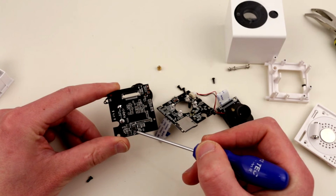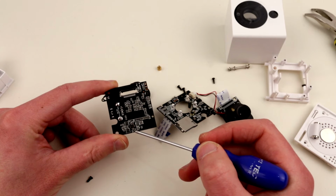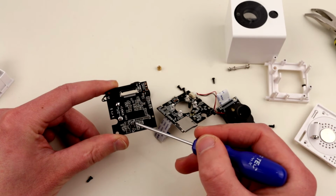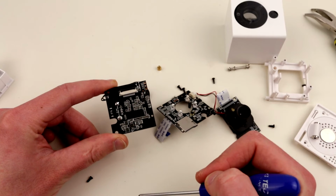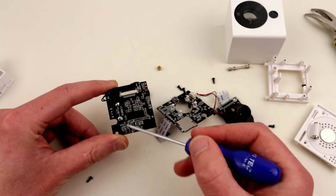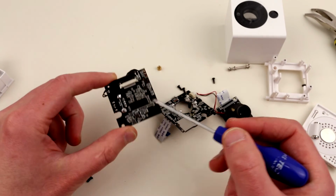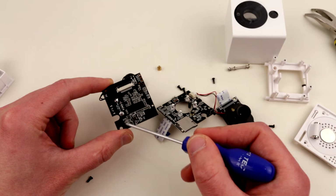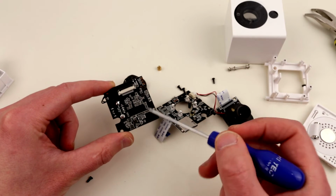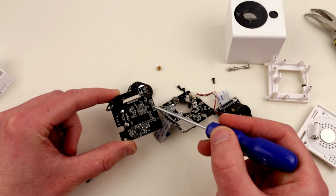So this guy turned out to be a 3-channel power IC, which has 3 synchronous buck regulators. And here we have 3 inductors, so kind of 3 regulators. I don't know if it's necessary for this guy to require 3 different powers, but we are clearly using all 3 channels over here. So another transistor, another FET over here.